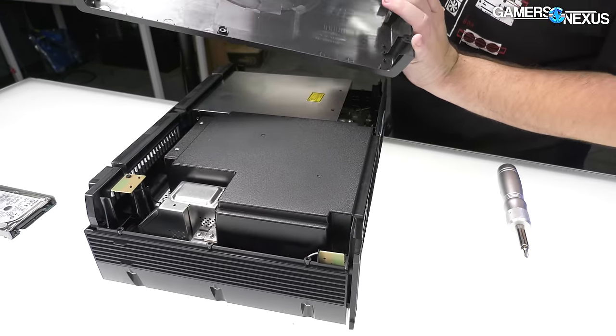There's what looks like either a humidity sensor or a post buzzer on the board. We looked up the memory module datasheet — it's an 8-gigabit (1 gigabyte) module. There are eight on this side and eight on the other side — 16 gigabytes total. That's actually a lot for a PS4 Pro; it's double the stock consumer amount. This is non-standard but typical for developer kits — they usually come with more memory so developers have more to work with. There's also a toggle in the software for larger or normal memory mode, probably related to this capacity.